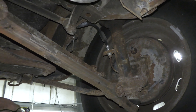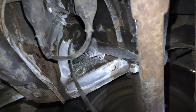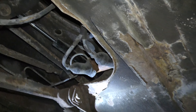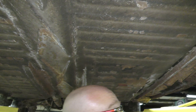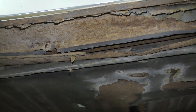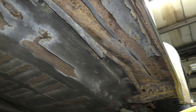It's a project car — they're going to take care of a lot of the stuff themselves, but they didn't want to mess with the clutch. Here's our little tiny steering gearbox — it's not power steering, it's not needed on this car. Here's our brake master cylinder. It does not have power brakes — just manual brakes. These floor pans are okay, decent, but so many of these have this area rusted out — this is the heater channel. So we talked about the heater blowing air through the exhaust — it actually blows through this channel all the way up and into the cabin. When these are rusted out like this you lose your hot air. Very common on these.